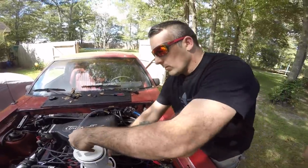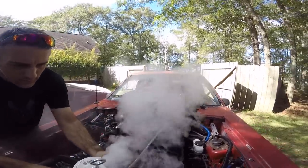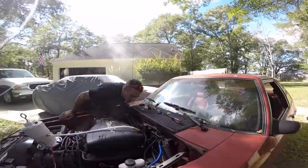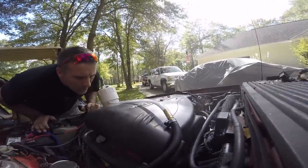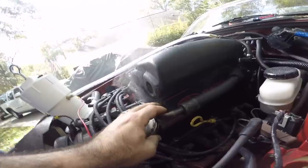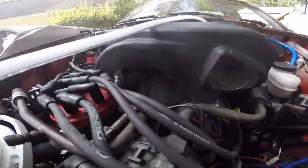She's gonna make some smoke — we're gonna cap that off. It's already trying to build up inside the throttle body. We got one down here somewhere. Intake! All right guys, there you go — as you can see we have a major leak. It's not the heads. Looks like the actual intake is leaking around the gaskets — if I had to guess, that's where it's coming from.